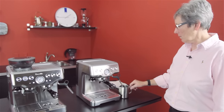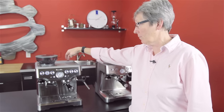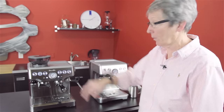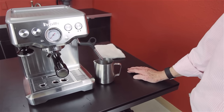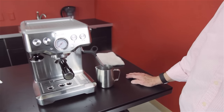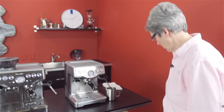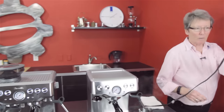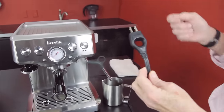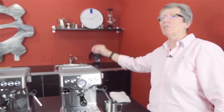Let's compare this one — should be about the same, just waiting to get up to temperature. The auto-fill feature means that when the boiler detects there isn't enough water in it, the pump kicks in and takes water from the reservoir automatically, so you don't burn up your boiler. One other nice feature Breville has: see this plug? You just put your finger in it and give it a yank. That's a nice little feature that only Breville has, as far as I know.